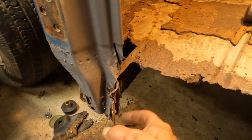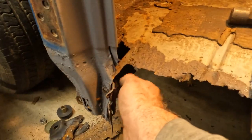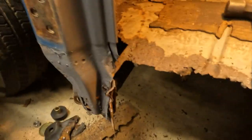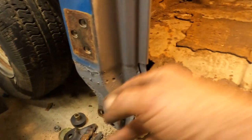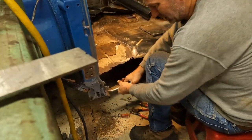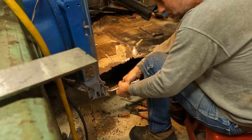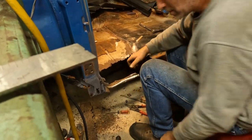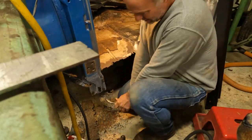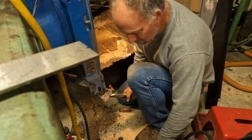Trying to get this inner fender out between the rocker floor support and the A-pillar bottom — everything's spot welded. I cleared some of this out so I don't get hacked up doing this. It's going along, but man, this is not fun. Luckily this support is in good shape — I just got to get the spot welds taken care of to get the pieces out. Then I can start to cut this out with my shear. How many spot welds did you use, Mr. General Motors?